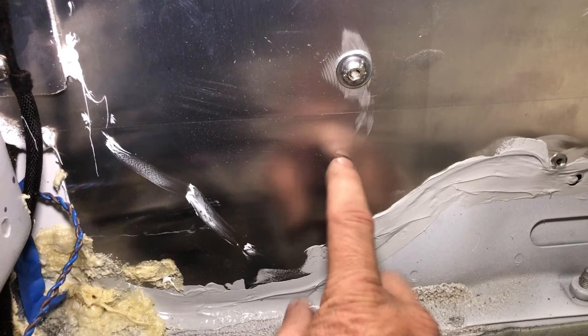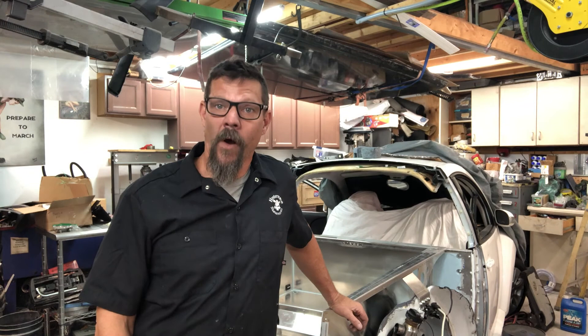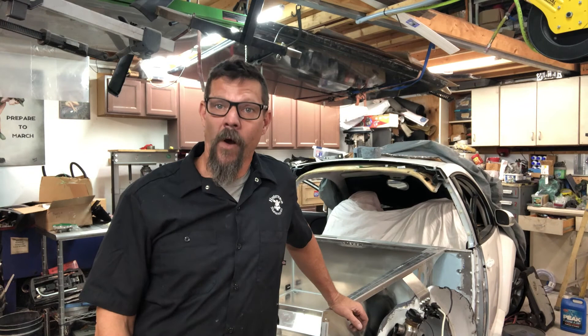Here we are looking inside the cab — that hole there is where water will come out if you didn't seal the holes. I run an extra bead after I get the wall all riveted in. You can see a little bit of that blanking plate. I'm still going to run a little more sealant across these seams — still letting some of it cure. That's my technique for sealing up the front bed wall and making sure water that gets in the floor pan doesn't end up in the cab. Thanks for watching — I hope this gives you some ideas. If you have better ideas, another technique, or an adhesive you prefer, go ahead and put it in the comments. Appreciate you watching, take care, be good to each other.